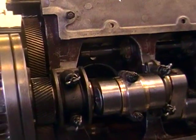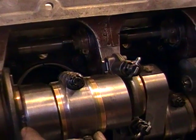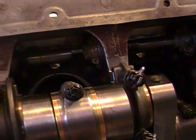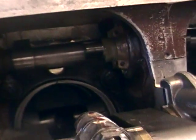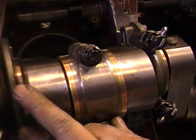What we're looking for is movement of this rod on the piston, and you can see it going back and forth. On a Rolls-Royce, unlike virtually any other car, the rod end play is set in the piston, not down on the crankshaft. For anyone who tries to do it the other way around, woe betide your engine rebuild.